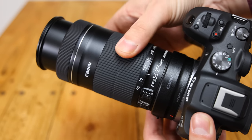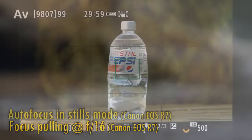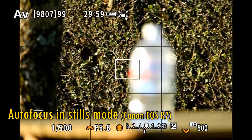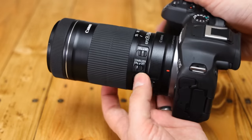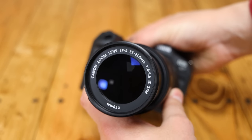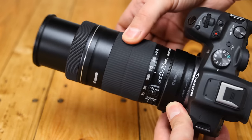In front of that comes the rather loose and freely turning focus ring, which is electronically coupled to the focus motor. In use, it works really responsively, as you can see here, and the lens exhibits very little in the way of focus breathing. The autofocus motor is from the early days of Canon's STM design, but still it focuses very quickly, smoothly, accurately, and silently — I had no problems with autofocus here at all. The lens has a 58mm filter thread size, and it does not come with a lens hood, although one is available separately. Overall, while the build quality is rather basic, the lens actually works fantastically well, with good stabilisation and autofocus, and a nice smooth zoom ring.